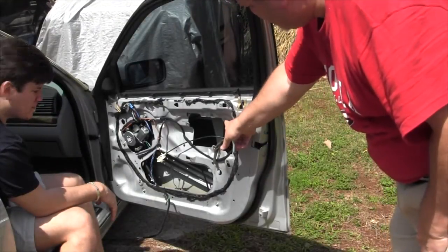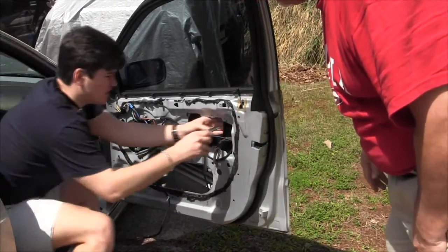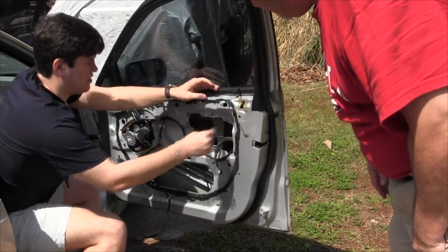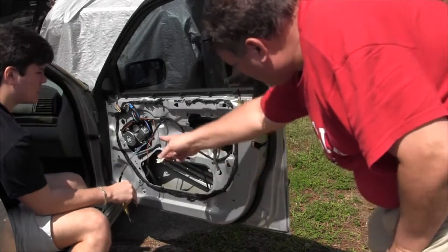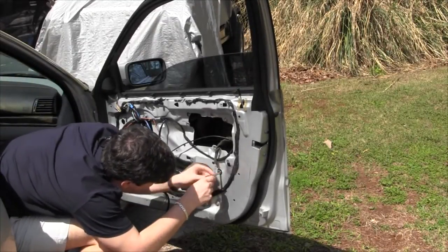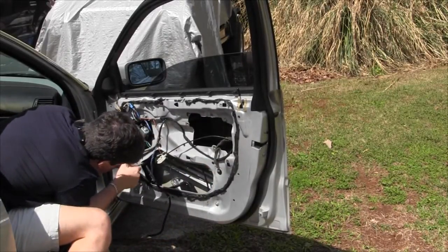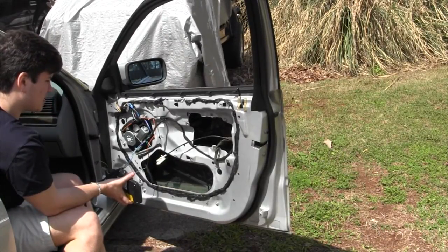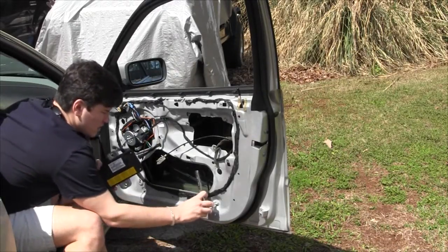And now you can go ahead and tighten with it up here. Now we can tighten this bolt because we know this is in the right position, the upper part of this tray. All right, now lower it down and we'll snug up this one as well as finish tightening the glass. All right, so next we're going to take it down to the bottom of the track, as far down as it'll go. That sets the proper width of the two tracks, and now we're going to tighten the bottom track.